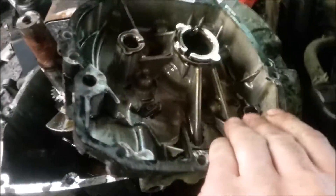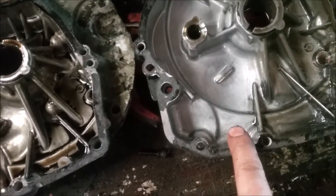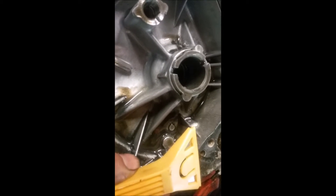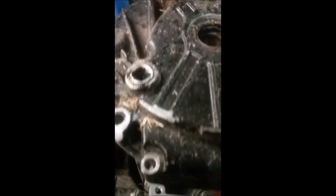Let's see what these look like. This one has an oil channel right here — that's the problem. This one's raised up just like my other motor; otherwise I'd say these two are identical. So I'm going to see if I have a gasket — as long as I do, I'll swap that onto here and we should be good. The hardest part is scraping off the old gasket, which is a slow and painstaking process, but it's got to be done. Old gasket scraped off, new one's on — different sump cover — drop that on there.